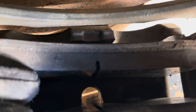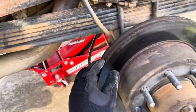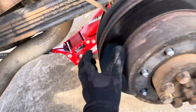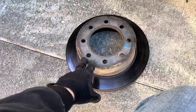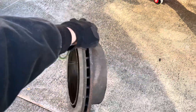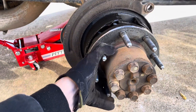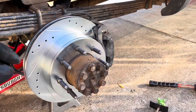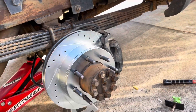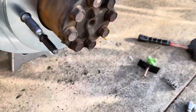I got new brake pads - these brake pads are brand new. The guy said when he bought it he just had brake pads put on, but they didn't put new rotors on it. If you've ever driven one of these trucks, all these early model Chevys are real bad about getting warped rotors. So I picked up some new rotors from Detroit Axle. Got this brake rotor on there - these are the same ones I used on my 05 2500, same brand, same process. It's quick and easy.